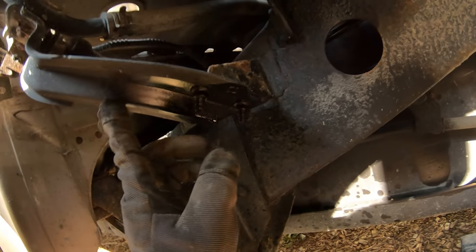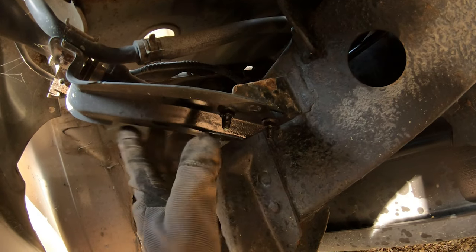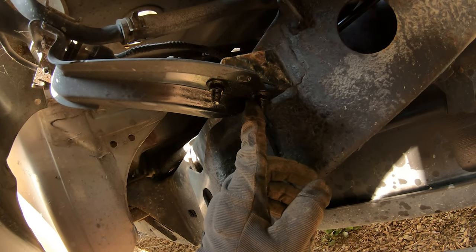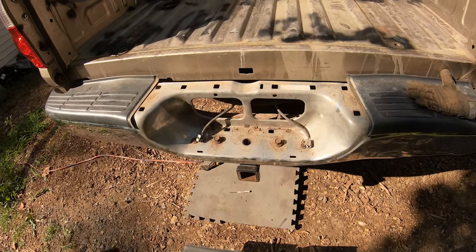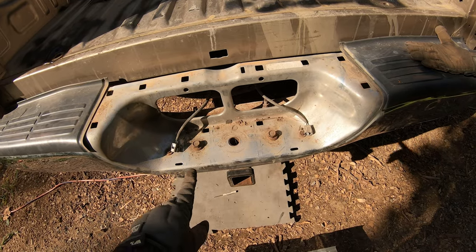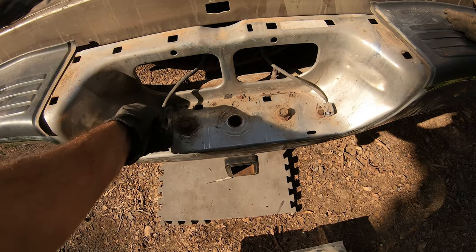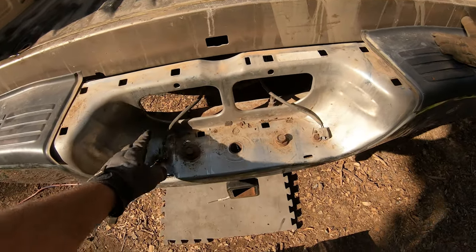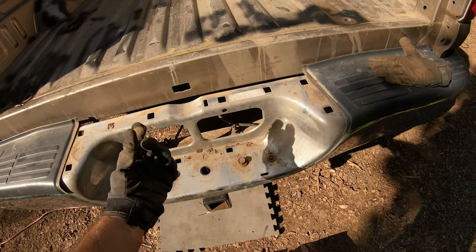One more thing: you have to take this arm off here where your feeder for the gas tank comes in — it holds that line in place. There are two bolts there and those are 12 millimeters deep, so you have to use a deep socket to get to those. You also have to take off this plastic cover, remove the license plate, and take out the light connections because those are connected to the frame and wired into the harness running along through here.